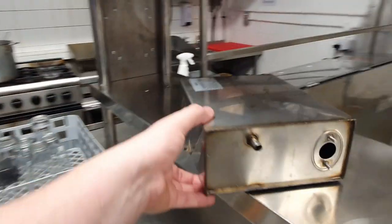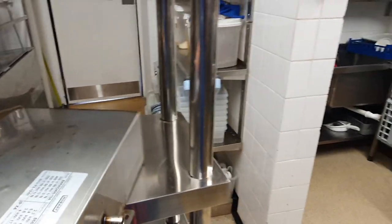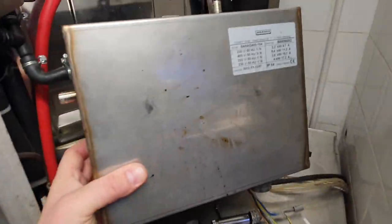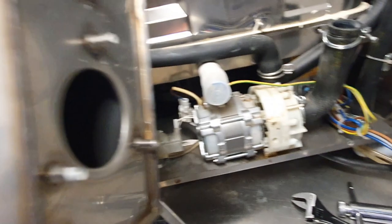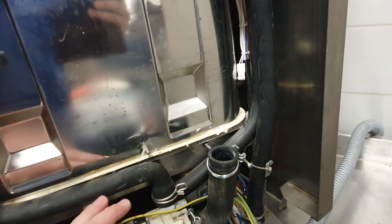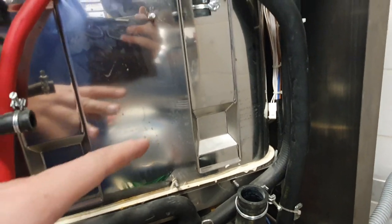The unit sits in that orientation, and you can see the outlets and pipes all line up. We've also got this cable loom here connecting to the element on that side. I was concerned that we were having an overheat trip, caused by the thermocouple sensing the elements getting a little bit too hot.